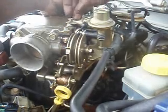We must always check all our vacuum lines, making sure we make all our connections. It is wise to label your vacuum lines so you don't forget any. If you do forget a vacuum line, the engine will idle above normal RPM. We will replace the accelerator cable in the same manner we removed it by hooking the anchor and the cable into the throttle body valve.